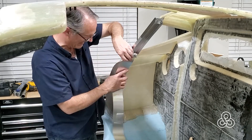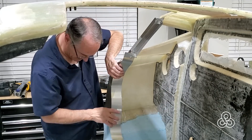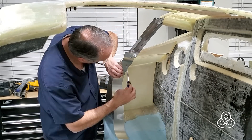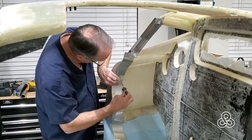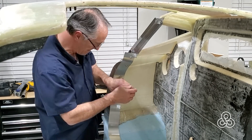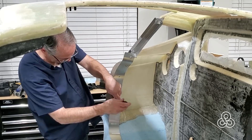Roll-forming that a little bit to give a curve to the aluminum, then using an ice pick to punch some holes through it and driving some nice flat-head screws — they turn easily into the foam and bite into it, sucking the aluminum right up tight against that joint we want to make.